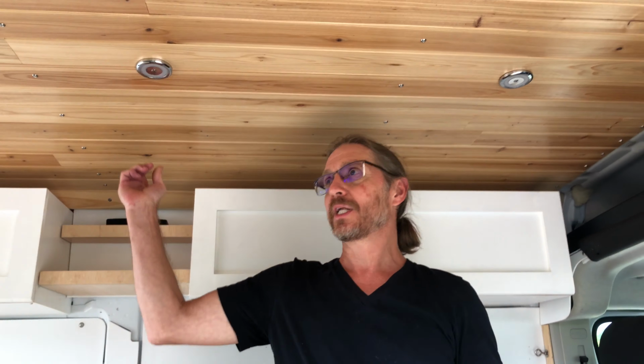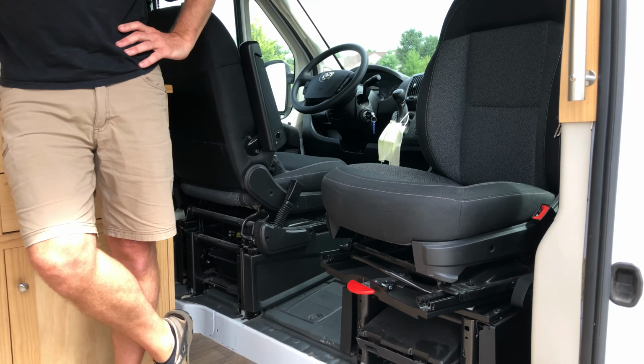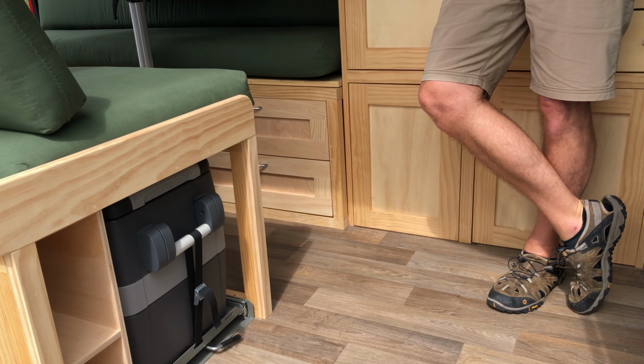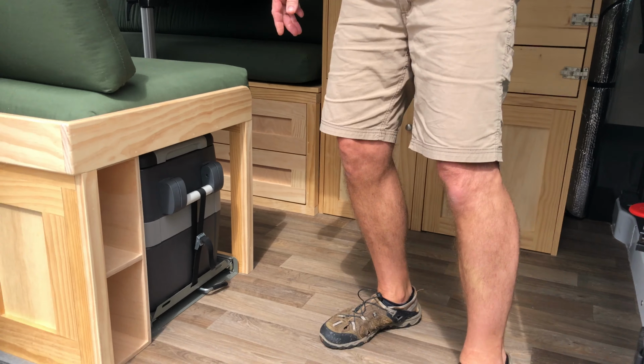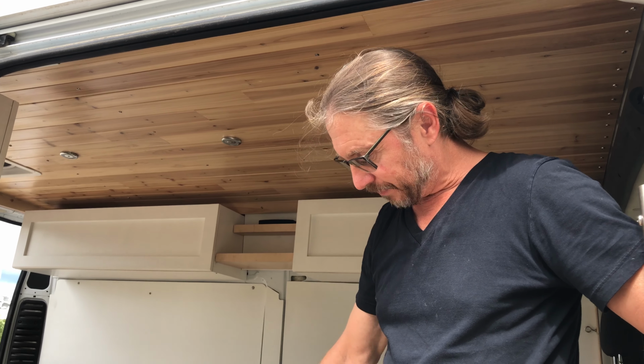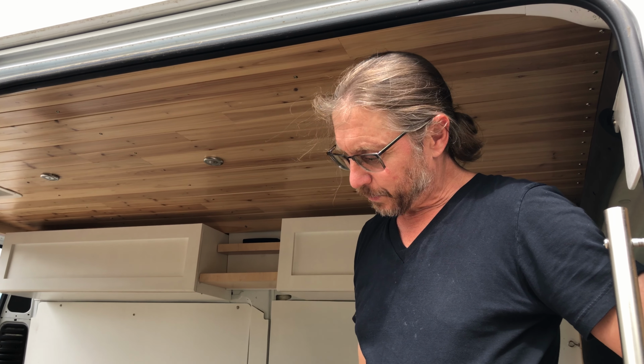So now you have the same ceiling, you still have that nice thin wood, but now you've screwed it in. I took out the magnets, put in 1/2 inch strips on the framing, and then put in a header board and a rear board, and mounted them with screws. All right, and so we have the swivel chair, which makes you a bit taller. That was a little challenging in the Rocky Mountains. What did you do on the floor? Floor is just 1/2 inch pink hardboard insulation and minimal framing, and then 3/4 inch subfloor, just plywood on top.